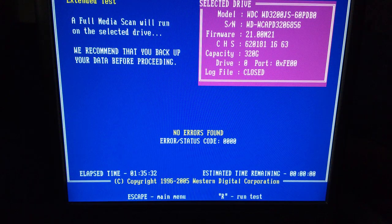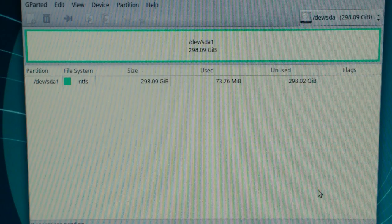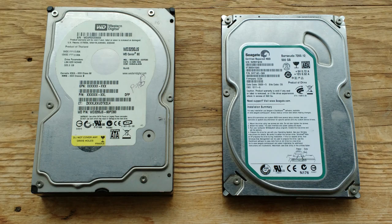We're looking good! After zeroing out the Western Digital drive, with no errors, we created a new partition table and formatted the drive. So with free software and the Hero PC, we've rescued two hard drives. These will definitely come in handy for building a new-to-me system. Thanks for watching, and remember to stay curious.